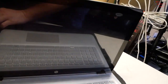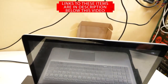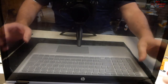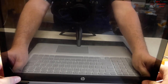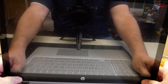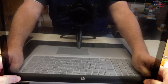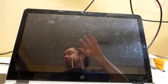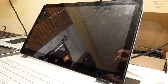So that means the entire top lid needs to be replaced. We're going to replace the screen, replace the top lid, and do all of that in this video. First thing I want to do — it's leaning forward just a touch — I'm going to try to cock this back a little bit by squeezing both sides where the hinge area is to work on it a bit better.